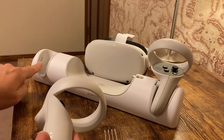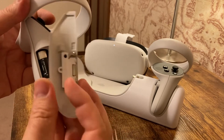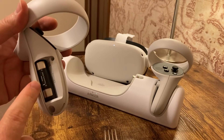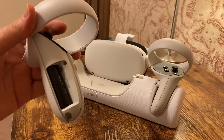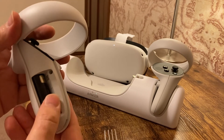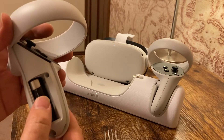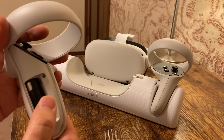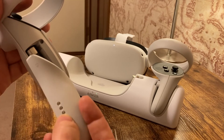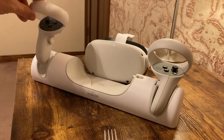The controllers have three prongs that fit and attach to three prongs inside the charging station. There are special covers — hand controller covers — that come with the charger. You don't use the out-of-the-box ones with the Quest controllers. What people mess up all the time is putting the battery in backwards, not positive/negative correctly. They treat it like a normal AA battery without realizing it has to recharge. You have to insert the battery correctly so the silver pads are on the outside. Watch the rotation carefully — even if the battery is slightly off, the connectors cannot attach properly. When putting the cover back on, look at the silver pieces, check where the three prongs are, make sure everything is nicely lined up, and pop it back on.